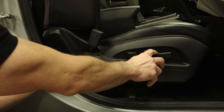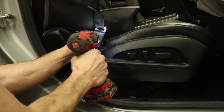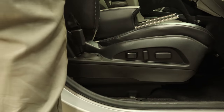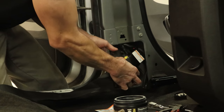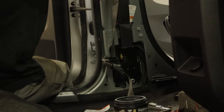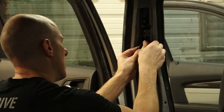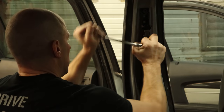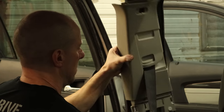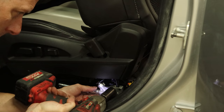Put our seat down, make sure nothing's interfering. And we'll put our seat belt together. The little motor part goes in and slides up, then you run the bolt in. Run it over to where it plugs in. Make sure we've got everything in the right order and nothing's twisted. Looks good. We'll head over to the driver's side. Put our retractor in, fold it in. Run the belt up the B pillar. There's a little clip in the center, a tab on the bottom that slides in on a plastic retainer, and up to the top. Use our torque wrench. Run the belt through and slide the trim panel up there and bolt it up. Plug in our tensioner. Line up that tab on the back and tighten it all the way up.